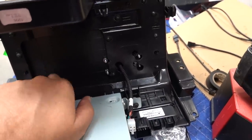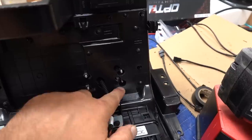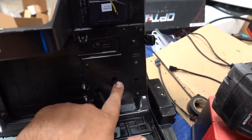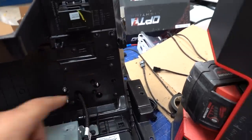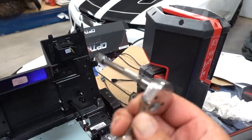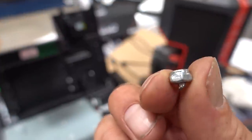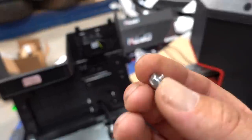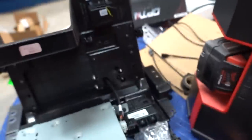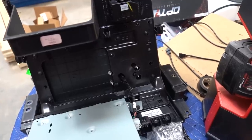I did run into a little issue on the back — there's another piece of plastic and rubber backing, and we have our lock nuts and studs for the panel. I had to drill the back out a little bit because the studs weren't long enough. But there was an issue with one stud: I was tightening it down with my quarter inch ratchet, going nice and slow, and it ended up breaking the stud right off in the nut. They are very brittle, so definitely use caution when tightening these down — I was going very lightly and it still broke.